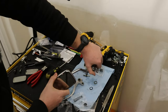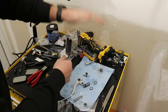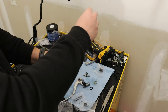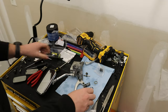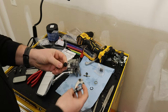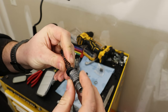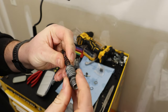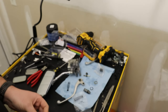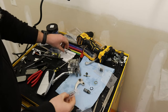When there's nothing holding it, the snap ring goes on there and then you push it all down and snap it into place — that's all there is to it. It's actually quite simple. When I was removing this snap ring, the spring really didn't return — I think the spring is kind of tired or the bore is dirty. If your spring gets stuck in there, just grab a pick tool and push it out. Genuinely, that's as easy as a clutch master cylinder gets.